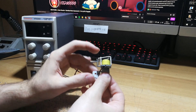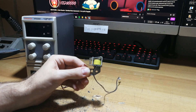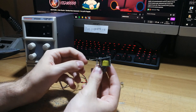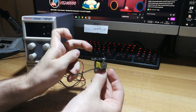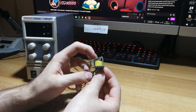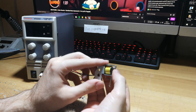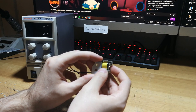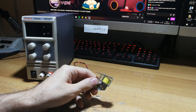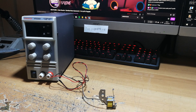This problem is caused by this — this is a solenoid. This is a very simple mechanism. Electronically, think of it as an electronic actuator. If I apply 24 volts of current to this end, it will close down, and this latch will go down and unlatch from a gear, permitting the gear to rotate so the printer can load paper correctly.